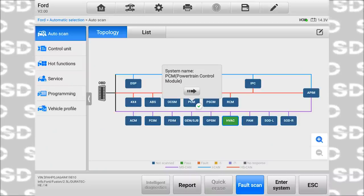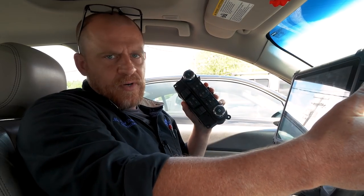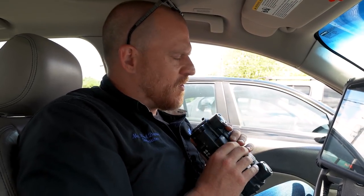So we're gonna get out of here and go to my engine computer, which is the one that controls the clutch. What my brother had told me is he could see the AC request signal was dropping out, and that AC request signal would be this climate control module talking to the engine computer. It says, hey, we're requesting AC via the CAN network. It doesn't have a specific request line that comes into the engine computer. I think I looked that up on a diagram when Danner and I were talking on the phone. He told me he could see the request signal dropping out, and he could take the scan tool in a bidirectional mode and make the clutch run all day long.